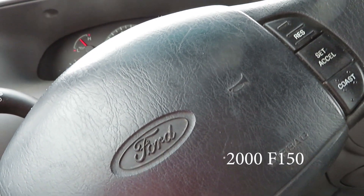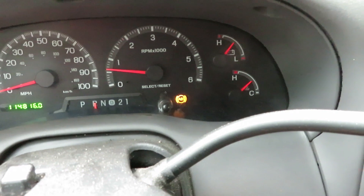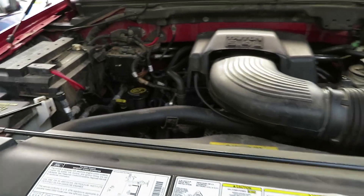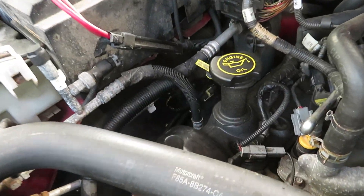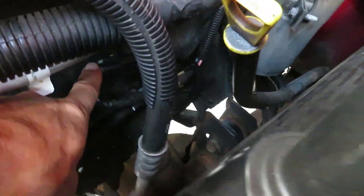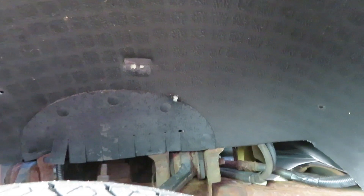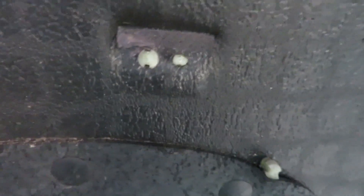In this video we're going to replace the right front ABS wheel sensor. In a previous video I showed how to remove the fuse for ABS in order to stop this annoying and possibly hazardous malfunction. There's the location of the connector, where the wiring goes in if you need to get at it that way to the wheel well from the engine side. There's where it connects on the wheel well cover. I'm going to take out the wheel well cover and work on it that way.